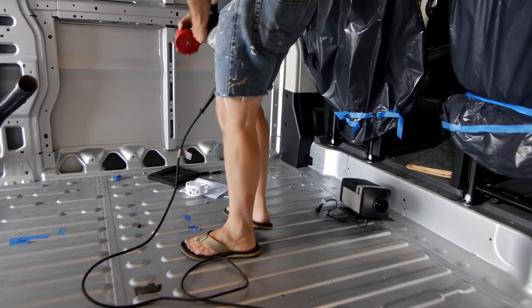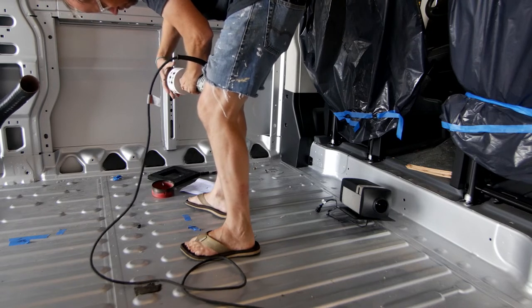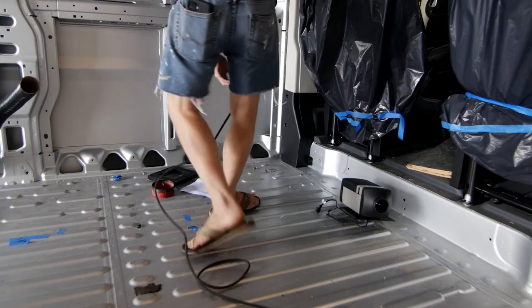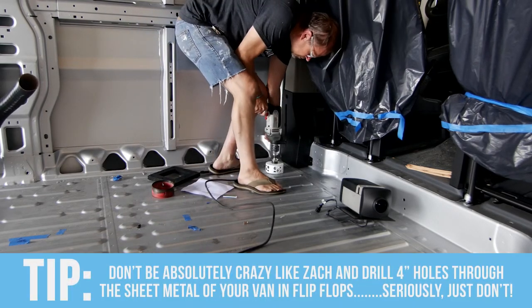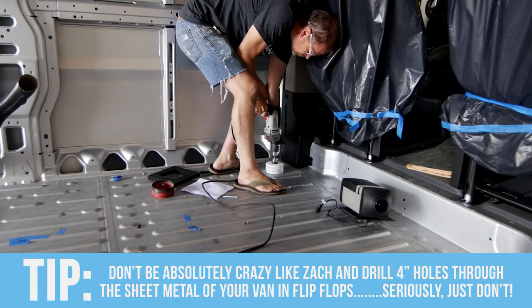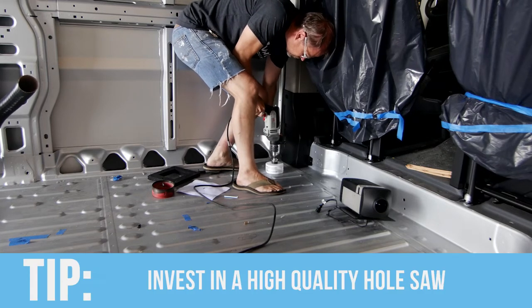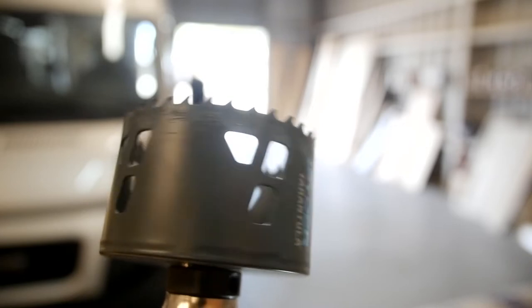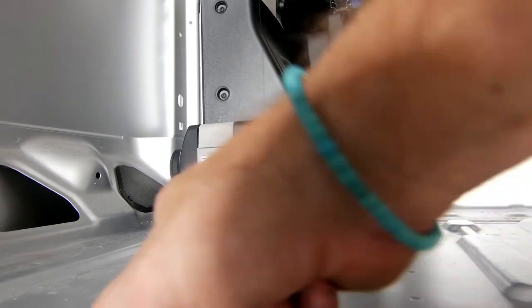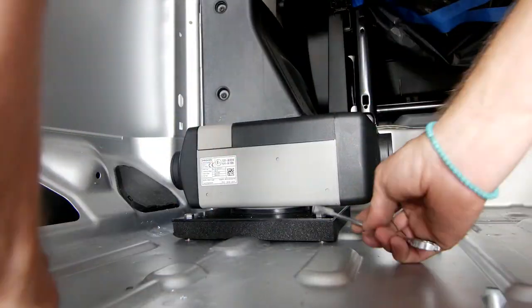Now comes one of the funnest parts — you have to drill the four-inch hole through the van floor in the location you've chosen. I've marked the location, cut the hole, and next I'm marking the location for each of the six mounting bolts using the paper template, though you can also use the metal mounting plate. It's definitely worth investing in a high-quality hole saw for this — four inches is a pretty big hole in sheet metal so you need good cutting power. We've tried a few brands and the Spider Tarantula brand has worked the best. Now we can drop our Webasto sandwich into place over the hole and bolt it down.